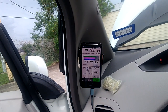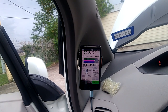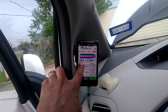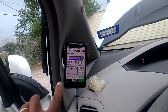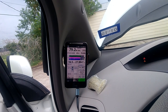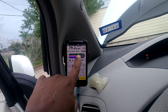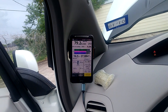If you want to buy a Nissan Leaf, Leaf Spy is a must. Let whoever is selling the car plug it in when the car is fully charged, then turn on Leaf Spy and look at what is remaining in the battery. From these two batteries combined, when fully charged and cut off, I'm getting a maximum of 21 kilowatts. It's supposed to be 40-something, or even 24, but I'm not getting that.